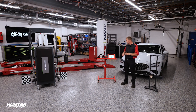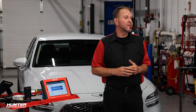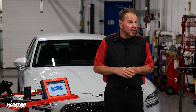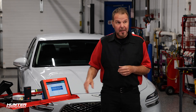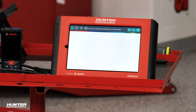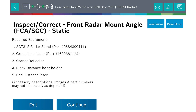We've got a couple options available for us — we're going to select the radar. You do have the option to do dynamic or static. We're going to go through the static procedure today. The reason I'm not going to go through the drive procedure is that's relatively simple — just drive the vehicle. However, when a vehicle like this has been involved in a major collision and the radar's been replaced, maybe the bracket was damaged, the static method would be the way you'd want to do it in a shop, and preferably with the front fascia removed. Our fascia has been reinstalled, which creates some unique challenges that I'll show you.